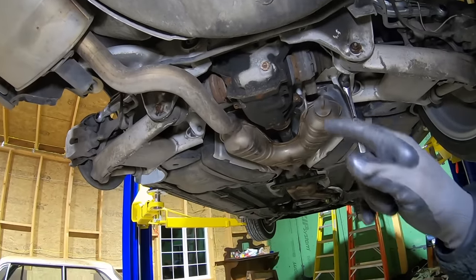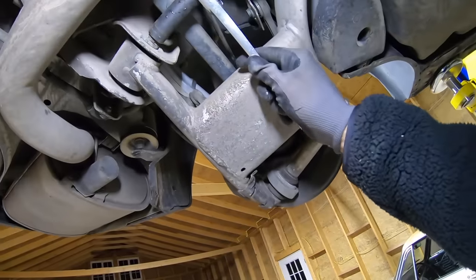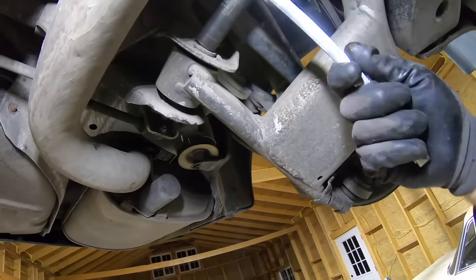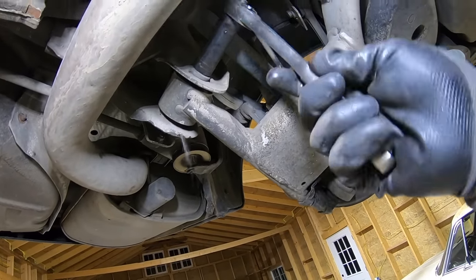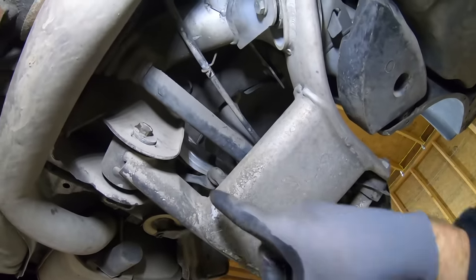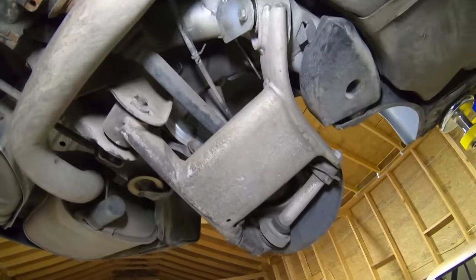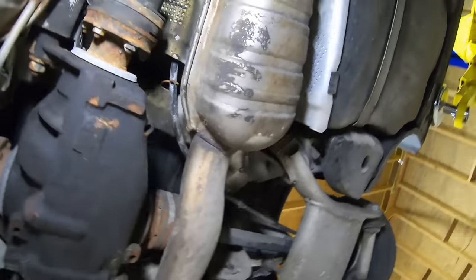You can see it moving in and moving out — go all the way in. Usually the biggest part of the lobes is all the way in right there. Now we're both set at zero. We'll tighten them down. Trying to think if there's anything else we need to do while we're under here.